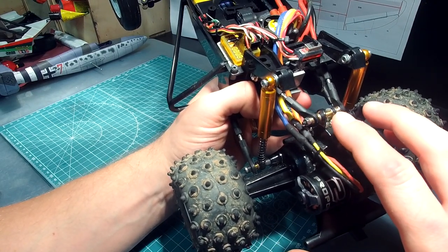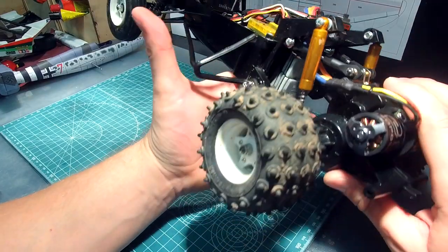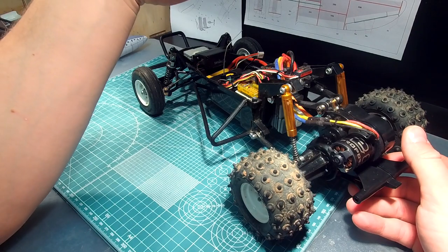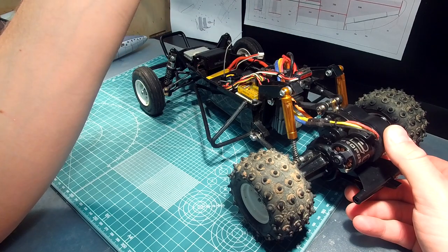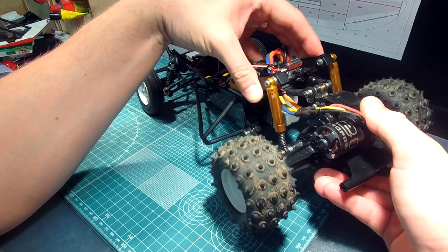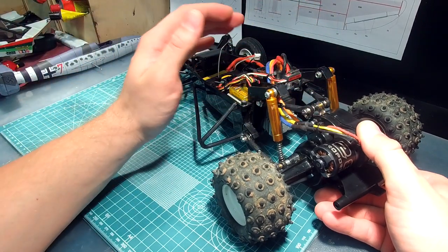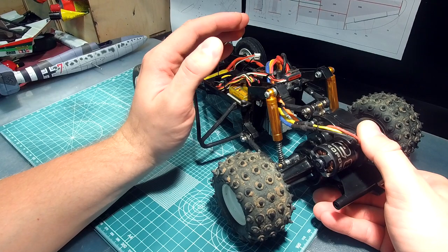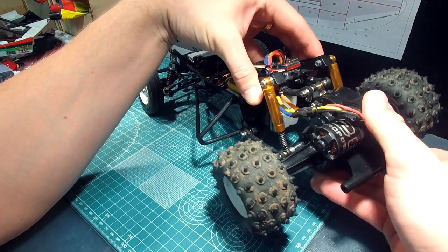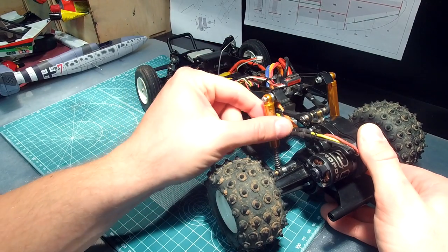You can see the top is triangulated. I used a few spacers because if you triangulate it too much it will bind. This solution is not perfect — compared to manufactured crawlers which have very accurate geometry, in my case the axle is pivoting around some imaginary point in space, not right on the axle. My geometry was made from the head, not from any scientific calculation, and it doesn't pivot perfectly, but it does the job.